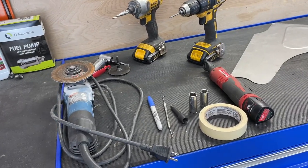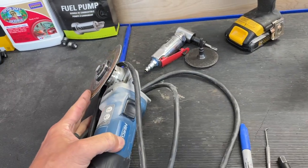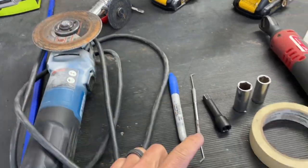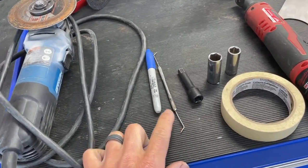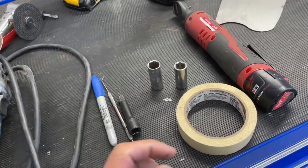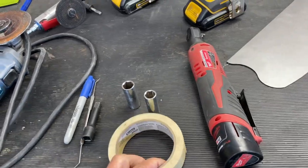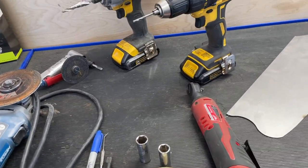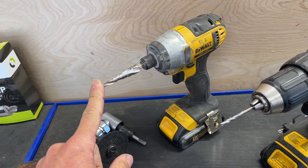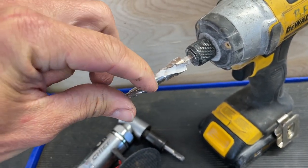Here's the small list of tools you're going to need. Not pictured is the number one tool — and that's patience. I'm using a grinder, or you could use a small die grinder. You want a Sharpie, some kind of etching tool — I have a dental pick here. You'll need a half inch and nine sixteenths sockets for the hardware on your fenders. I use a cordless ratchet because it makes life easier. Some tape for the stencil, and a drill with a small bit — I love these step bits; they're perfect for this application, especially if they have long steps so you don't drill halfway through the material.